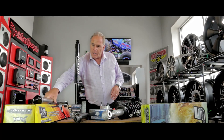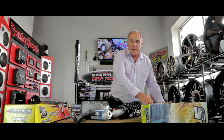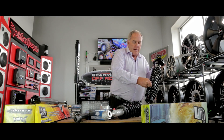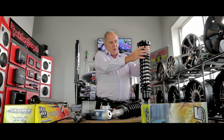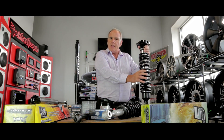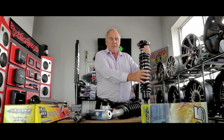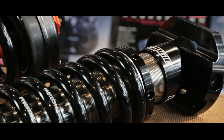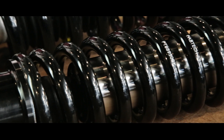When we're talking about lifting a little farther than two inches, Fabtech for the F-150 this year has a brand new four-inch kit. Here's the difference between a basic lift kit and a performance kit. A performance kit is going to give you the entire strut assembly — both the spring and the shock inside the strut — designed for the larger wheel and tire, up to 35 inches in this case, and the weight that that tire brings.